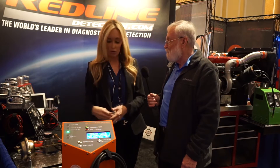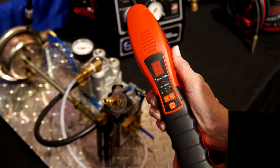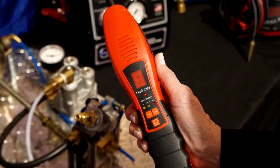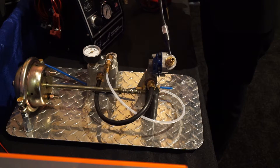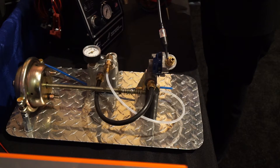If there's a tiny, minuscule leak, it may say you're good to go. And as we know, little leaks over rough wear and tear on the road become bigger problems, so the next time it's tested they may need more attention. If it says you've got a leak that would fail DOT standards and possibly result in a red-tagged vehicle, then it walks the technician through how to pressurize the system. It uses a signature air with a very tiny molecule, and then it's possible to use — let me show you right here — a sniffer that's very much like people use in testing air conditioning systems, to go throughout the system and actually pinpoint the leak to the exact location.